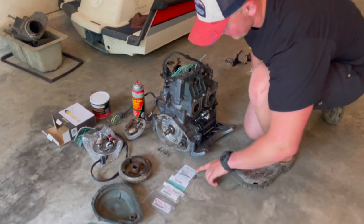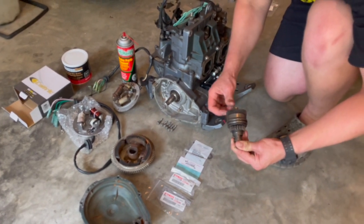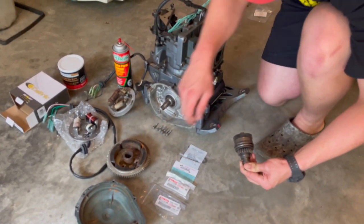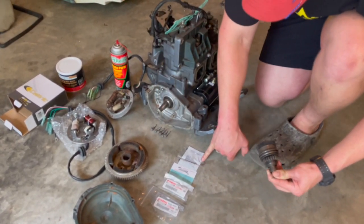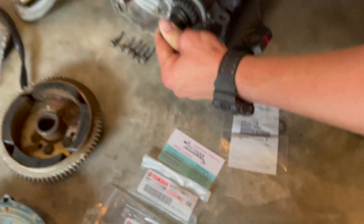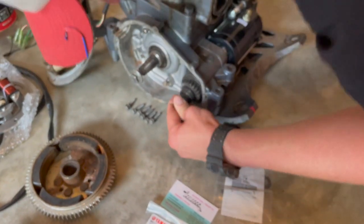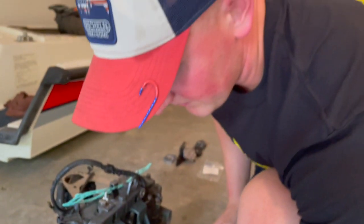So what we've got here, before you put the starter Bendix on, you have to first grease it on the back before you put it against the case. There's a washer. There's the part number for you guys on the washer. I don't remember what company I ordered that from, but I will put the link in the description. And if I forget to do any of that, just comment and I will get back to you.